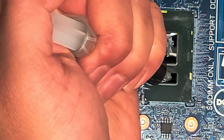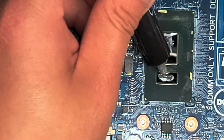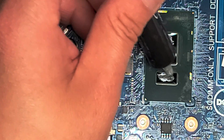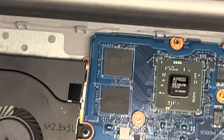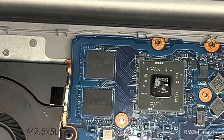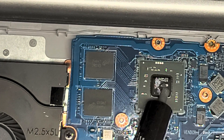Here there's a thinner chip, so you put a lot less. And on this chip, since it's a square, you don't want to make it a grain of rice shape — you just want it to be like a small dot or little ball. If you put too much, it'll go out to the sides and kind of just hold the heat there, so you want it as precise as you can.